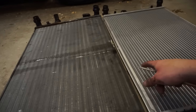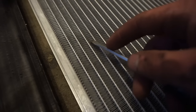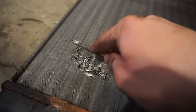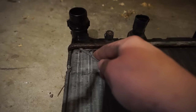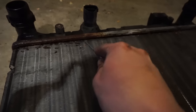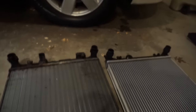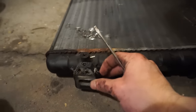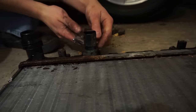Here's the side by side of the two radiators. You can actually see the new one has flat squashed tubes and aluminum heat sink material in between. This old one has aluminum sheets with tubes punched through - it's all falling apart from the salt and stuff. You can see where some of the pink coolant leaked through and dried out - yeah, look at that, that's where it was definitely leaking. Here's where I broke off one of the screws, and there's another one that broke off down here. These bracket things on the top and bottom go on there - probably to account for thermal expansion of the radiator. Now we're gonna get this sensor off of here.